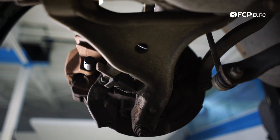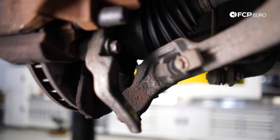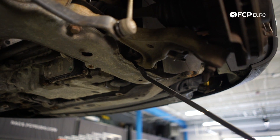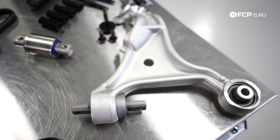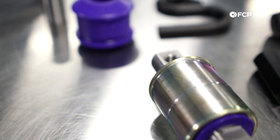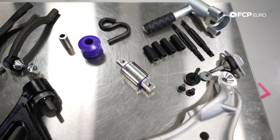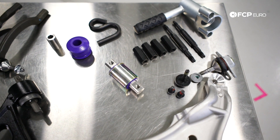Next, I want to talk about the control arms and control arm bushings. Many P2 owners will most likely have to replace these at some point — they're very common to go bad. Worn out control arm bushings cause poor handling, wandering and vague steering response. When you're under the car, you can use a pry bar and apply some leverage; if they seem really loose or floppy, it's time to replace them. We offer complete control arms with the bushings already pressed in so you can just bolt them on and go. For the avid enthusiast, we also offer PowerFlex polyurethane bushings, which stiffen up the front a little bit and, once greased, will outlast your Volvo. The mounting hardware uses a torque spec with an additional tightening angle, making these one-time use only stretch bolts — you'll have to replace them every single time they're loosened.